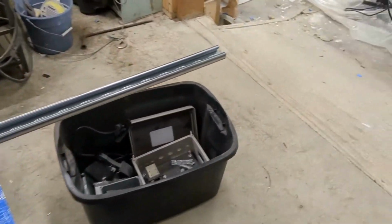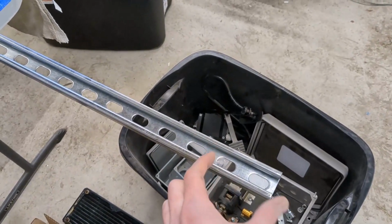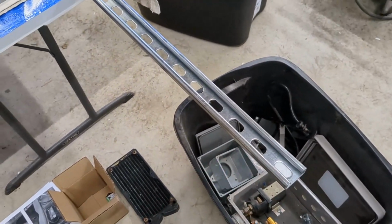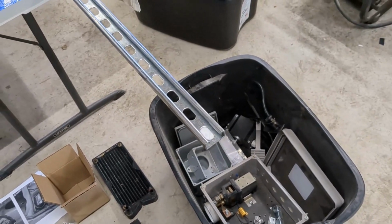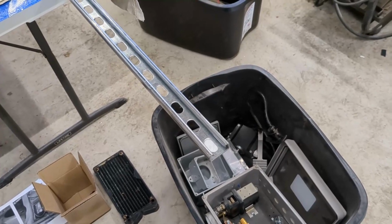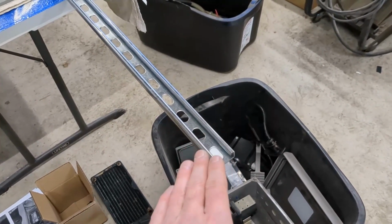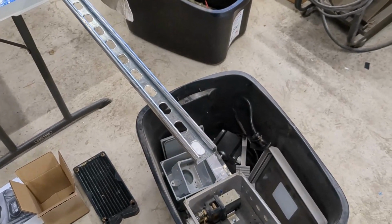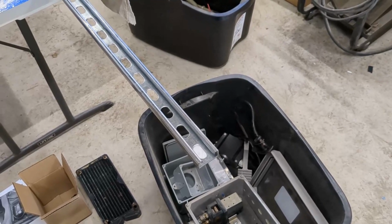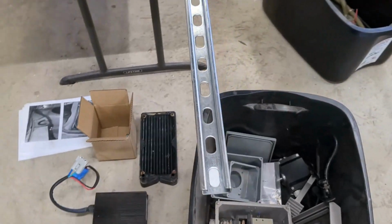In addition to that, since this is galvanized, I was thinking about welding the uprights and the box frame together, but I thought, since it's galvanized, I don't really want to risk my health if I weld on galvanized, which is essentially just zinc-coated steel. The zinc fumes from welding are bad for you. Not that I wouldn't do it. I could hold my breath, do the plug weld, walk away, let it air out, and go like that.